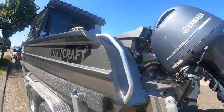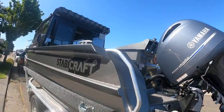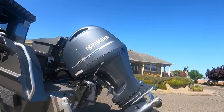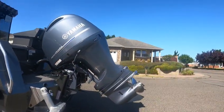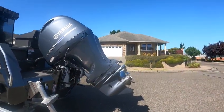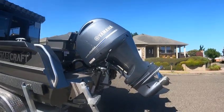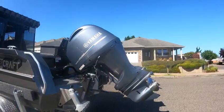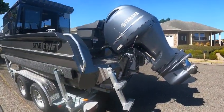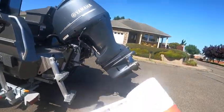It's 31 feet, $99,800, 10 feet tall on the height. They recommend 2x150s but the 200s have their RPM kick in at 2,200 — you're probably going to get better gas mileage than with the 150s, plus you've got that low-end grunt at quarter, half, three-quarters throttle. When you hit it, it goes. The RPMs kick at 2,200 versus about 4,600-4,800 on the other one. Fuel tank size I already told you. Dead rise is 19 degrees.